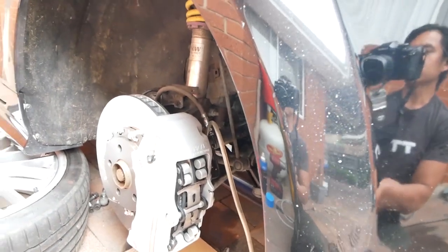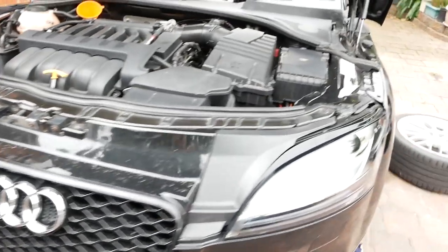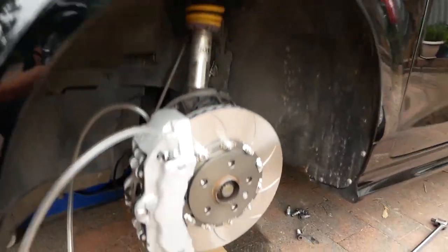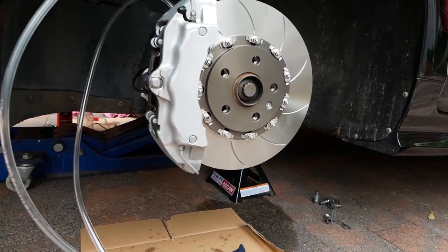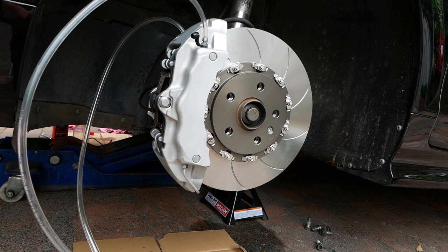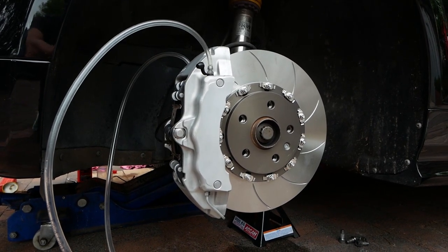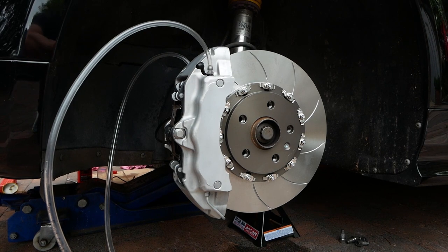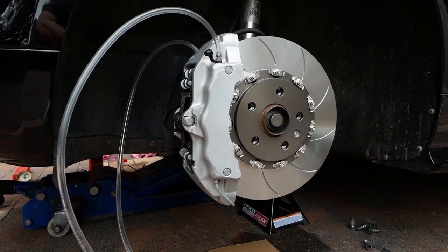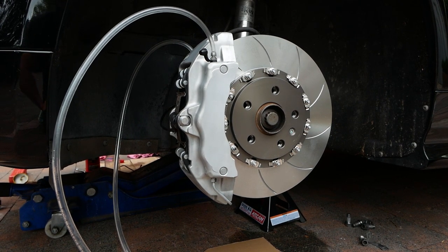And then what we want to do is fire up VCDS to use the sequence that's in the brake or ABS module. I'm going to leave one camera here, and I'll get the head camera on so you can see exactly how much work is needed to do the VCDS brake bleeding procedure, which is especially going to be helpful if that master cylinder or the ABS pump has been run dry.